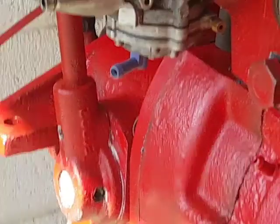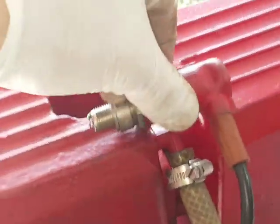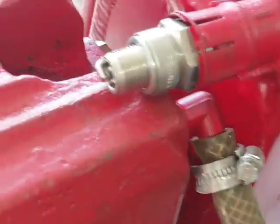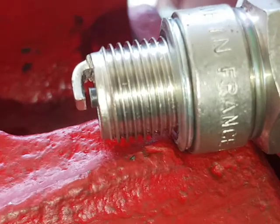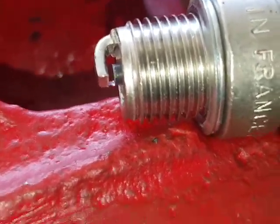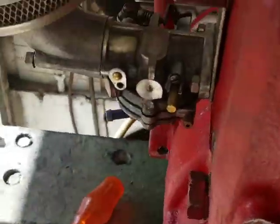That is how to set up the timing. I'll put this back on the tripod, put a spark plug in, and hopefully you'll see that it works. I've just rigged this up quickly — I've put a spark plug here, it's just resting on top. The spark should be able to jump through this. If I just turn this over... lovely spark. But I should point out this engine has got no fuel in it — I've just rebuilt it, otherwise it would be dangerous to put the spark near the hole.